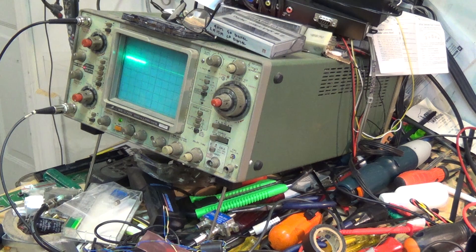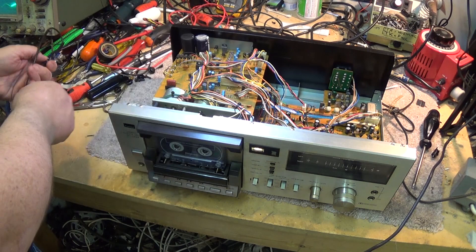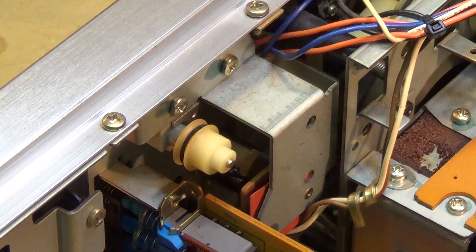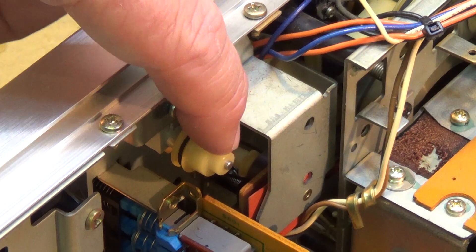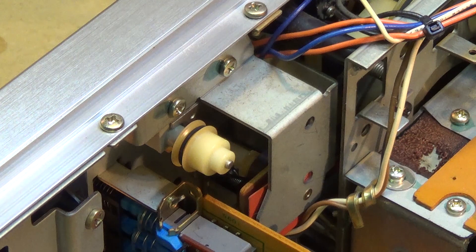The problem we've got on this deck is a pretty simple one to solve. I know it's mechanical, not electrical, because when I first plugged the unit in the tape counter was not turning. So we either have a belt that's slipping — a lazy belt that's getting a bit worn — or we've got a problem with the actual gear and grease. Maybe the grease on the worm gear that turns the actual tape counter rollers has gummed up. If that sticks, you're going to have the magnet below it not turning. We're going to take this thing apart, lube it up, and check the tension and belts.